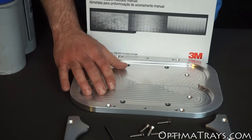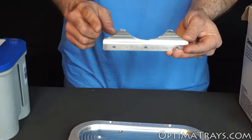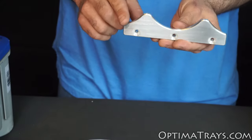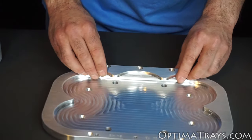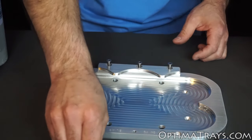So before you install your battery into the vehicle, first what we need to do is install the slip clamp. The slip clamp is designated by 34-SC for slip clamp, and can also be noticed by the more round points. First set that on the battery tray and insert the three screws. These three screws can be tightened down all the way right from the beginning.